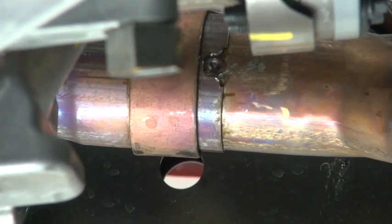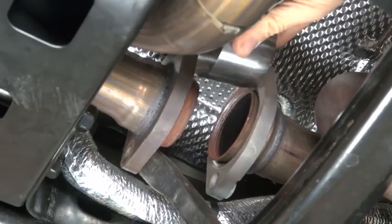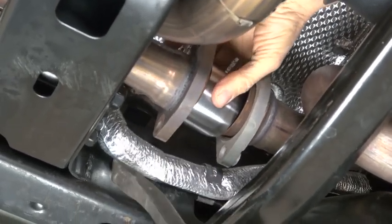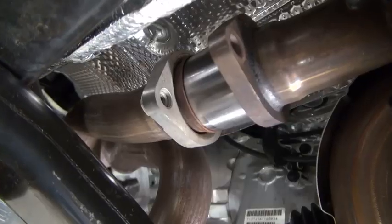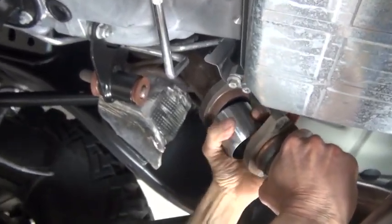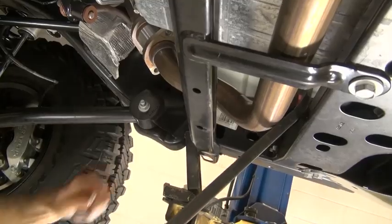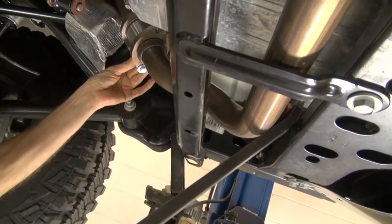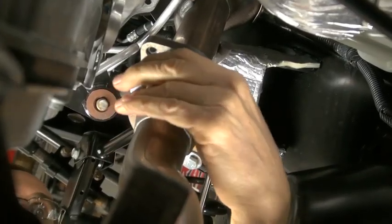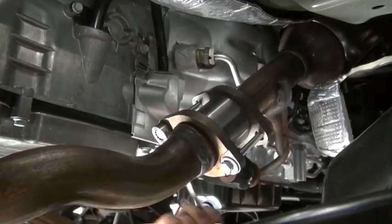The exhaust system can be easily pried back using a pry bar between the front skid bar and the exhaust flange on the driver's side. Install the spacers on both sides before tightening — the short spacer goes in the driver's side pipe and the longer spacer in the passenger side. Position the spacers to line up the two sections of pipe as much as possible before tightening. Install the extended 8-millimeter bolts provided in the kit and tighten them using a 13-millimeter. Make sure there is good clearance around the exhaust system.